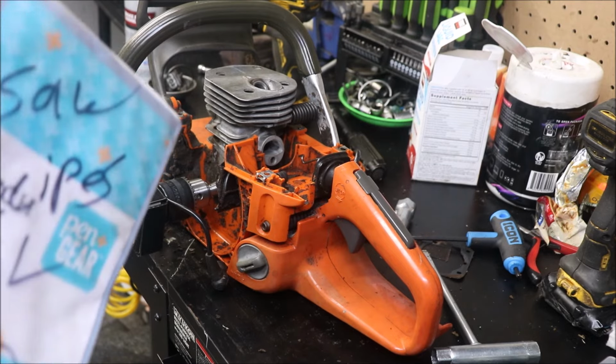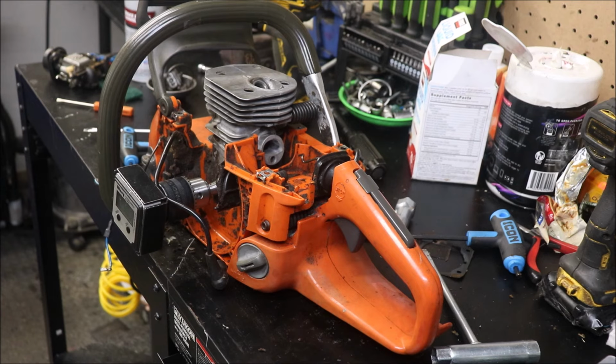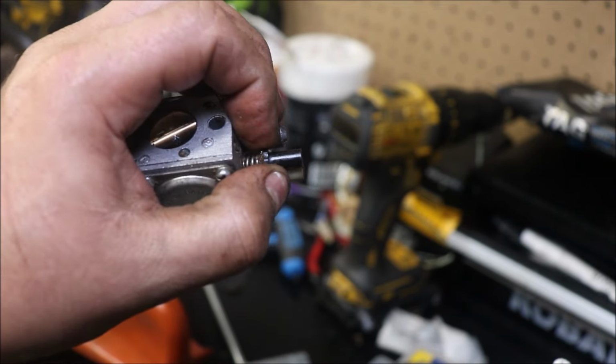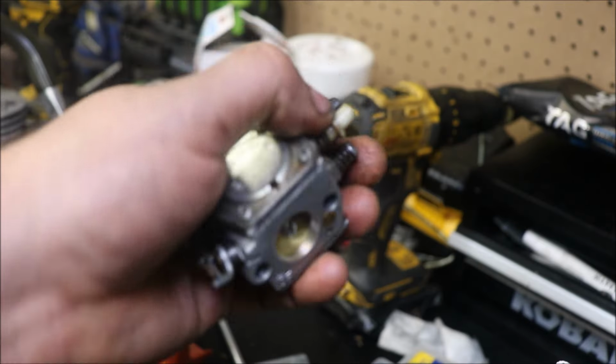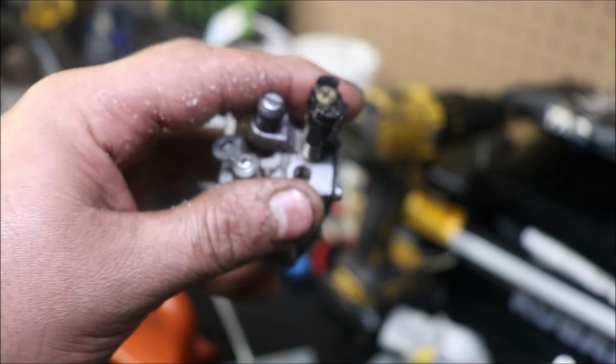I've got to pull the carb assembly apart. Unfortunately, but it's a good thing too, this thing has limiters and no one's taking them out. So I'm going to get that done and I'll bring you guys on these limiters. You can see there's the little hump, I guess, or the detent. What I'm going to do is take a double cut and grind those down smooth, and then put the cap back over that setup that goes on it, and it should be good to go. Those ground off smooth, the cap placed back on, and it looks completely stock.